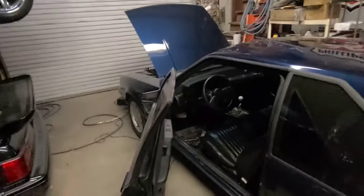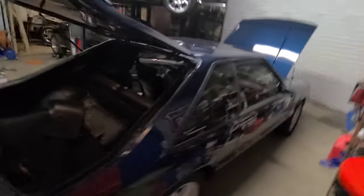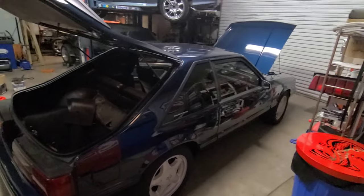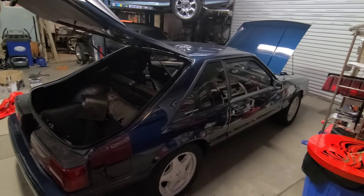My buddy says when I put the motor in, he goes, well, what do you think? I said, well, most times I do one of these, and I pull one of my motors out that I've had in a car for a while, it's almost like a boat motor. The water pumps are almost always going to be faulty. You know, they're going to leak. If they sit still for too long, the impeller isn't going to do what its job needs to do, and it's going to have a leak. It's not going to build pressure.